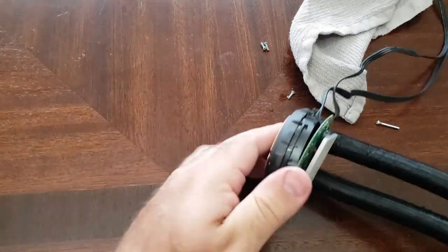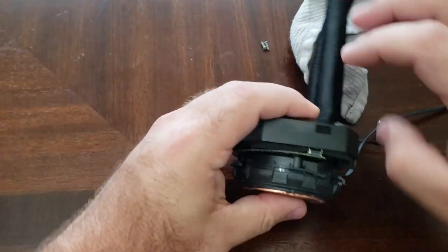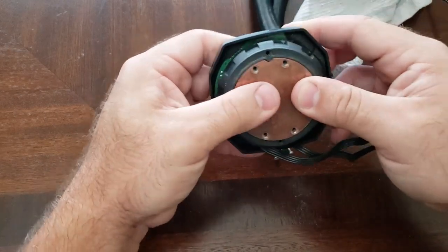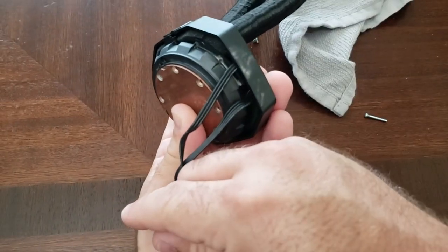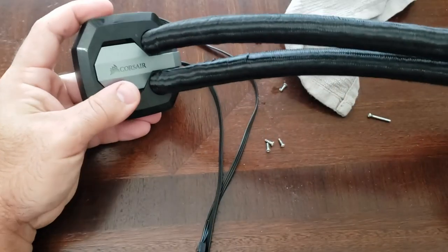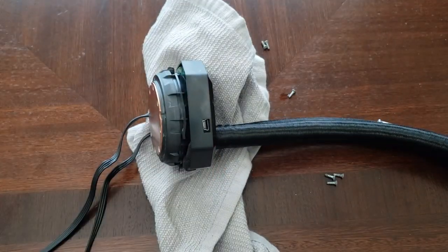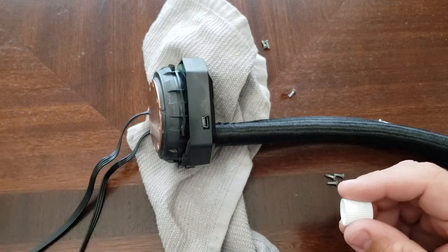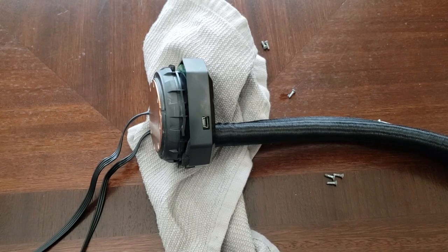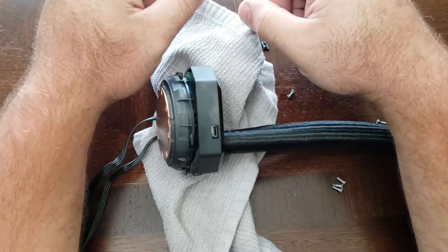Once you're done filling, put the board back — it slides right on, just push hard enough to line up the USB. The cables will just drape down off the side. Put the four screws back on and you're ready to go. Run it a little bit to make sure there are no leaks. If you have any questions about AIO or cooling, comment below. Subscribe — I'm going to do some cool things with this AIO, use it as a water block for a custom loop build. I also have an automotive build coming with nitrous and LEDs, so stay tuned.